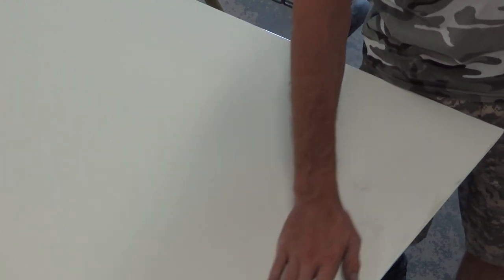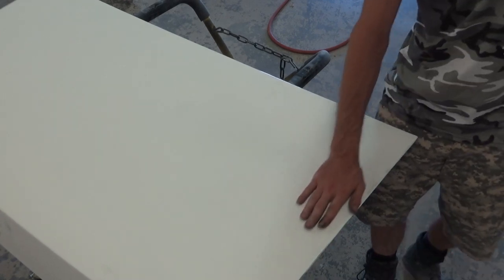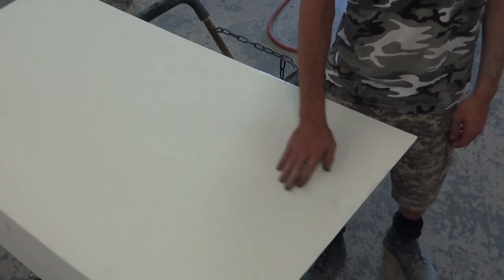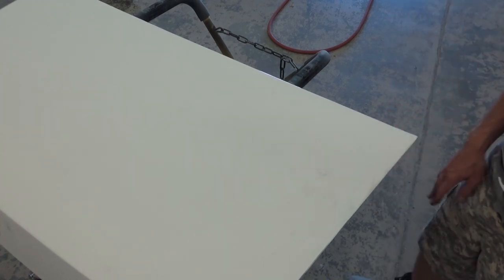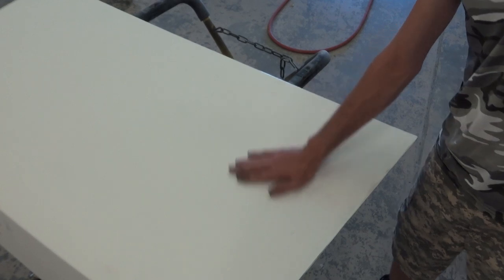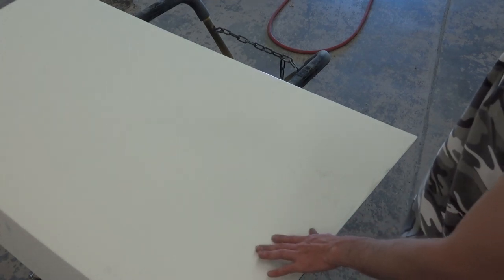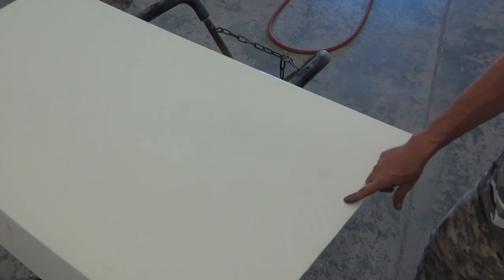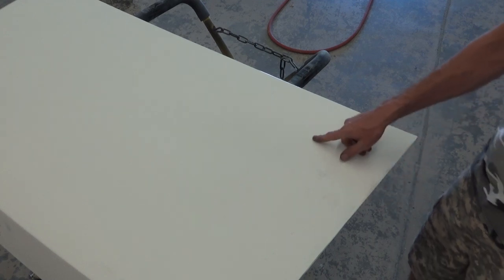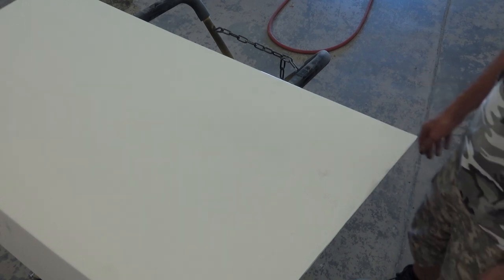This whole area is actually low but not bad enough to warrant body filler — it's almost blocked but not quite. I didn't want to hit sheet metal, so I'm probably going to put an extra coat or two of primer surfacer in that area. These little pinholes are probably worth your time to skim with a little body filler — a really, really tight coat — just to cover these little areas so the primer goes on better. I'm going to scotch-brite the guide coat out of those little problem spots.